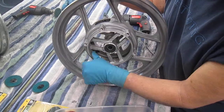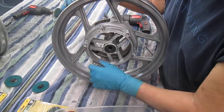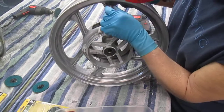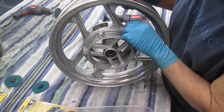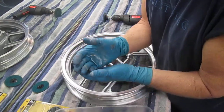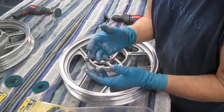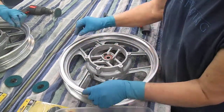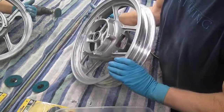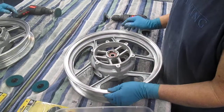You can actually see the casting in here — this is the front wheel. So I've gotta sand this; I'll have to do by hand of course. But this little wire brush will be so handy to get in here — I can get 80, 90% of it. The point is I'm going to put a lot of hours into this, and I don't want it so that at the very end, you put the last coat of clear on and there's a spot the paint isn't adhering to. So it's cheap insurance to try to do this. And it's dirty, disgusting work of course.